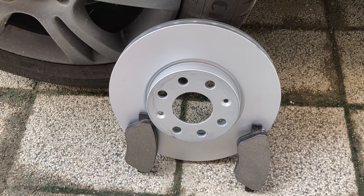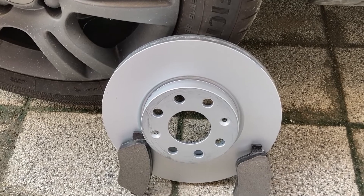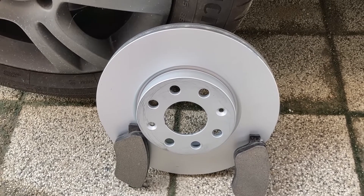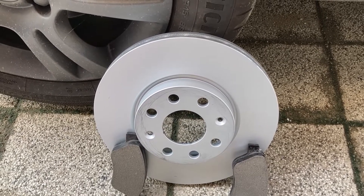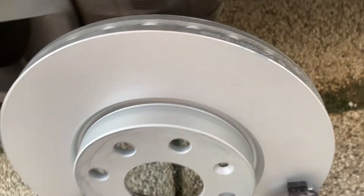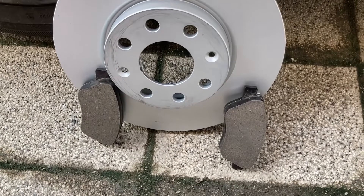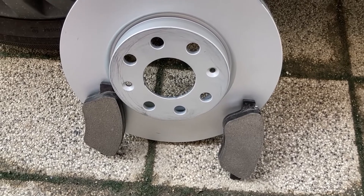In terms of components, I'm sticking to ATE — the same ones I used for the rear of the Range Rover and all the brakes for the Kia. I do this because they've proven to be good components; they're not sponsoring me or anything, this is just my personal opinion. These coated rotors remain in good shape over a longer period of time and don't show signs of too much rust. The 90R certification basically means they're within 15% deviation from genuine Opel brake specifications. The pads, just as before, are ceramics for lower dust, no noise, and longer life.